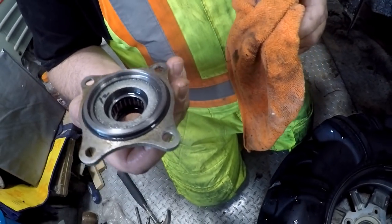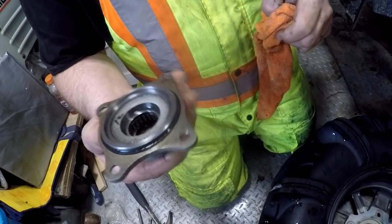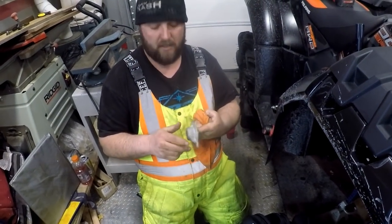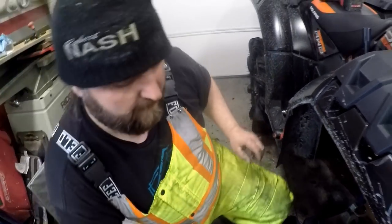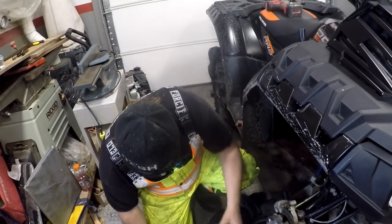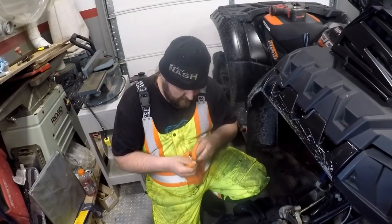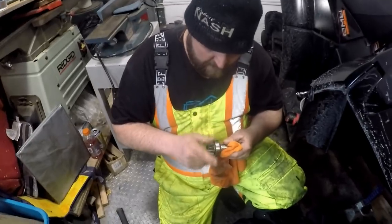You know, they're brittle. Yeah. For sure. That, or maybe it doesn't have just a tad of flex. That's a new cover, but I blew that bearing. I broke the bearing, but maybe the bearing went bad and then blew itself up and chewed up. But a couple guys told me that the cause of it sometimes is the seal going. So you get a little water, turns to ice, in around your bearing a bit. Yeah. And it could be hard on them. Because I blew that bearing right there in two.